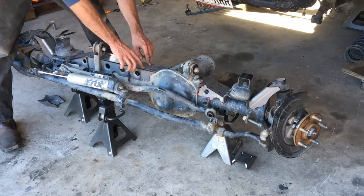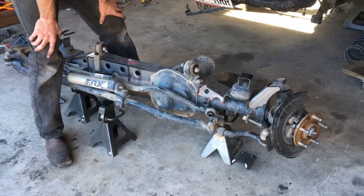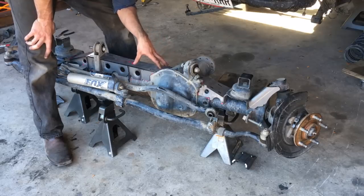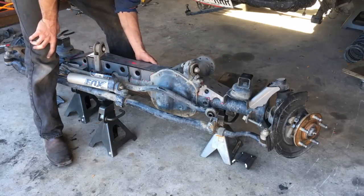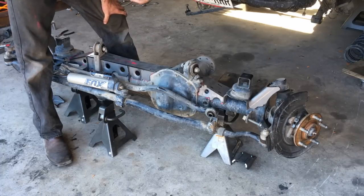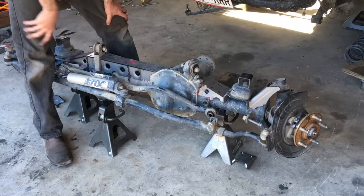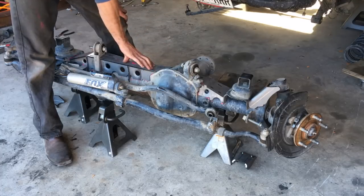Once the gussets are welded on, you can weld the top piece on. For the center, because it's cast iron — not mild steel like the tubing — welding there may look great but there's a good chance it may crack. The smart thing to do is get a torch, heat it up right before you weld, then lay down small welds moving around to transfer heat evenly. Don't do it all at once because you have seals inside your tubing and your differential can go bad. Take your time. When you're done, get a welding blanket — Harbor Freight has them for $10–$15 — and wrap that area and let it cool slowly. If it cools too quickly, your welds will definitely crack. You can use a nickel rod if you want to do it properly, but flux core works too. I've done tons of these and haven't had a single one crack yet.